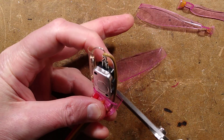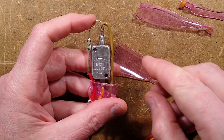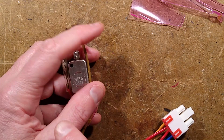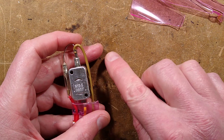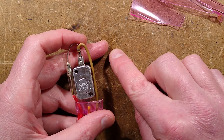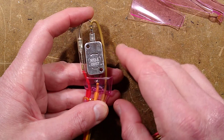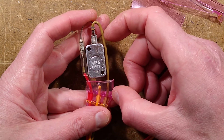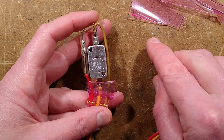It's quite interesting the way these work because everything's cost-engineered. There's a geared motor that initiates a defrost — it's very slow, with a little cam that swipes around. When it turns on the heater, it switches the motor itself off. And then if it were to continue, it would almost immediately switch back to the motor running again. Because of the way it's configured in the circuitry, the motor switches itself off and brings the heater on. But as soon as the heater is up to temperature and the thermostat goes open circuit, the motor is effectively wired across it — so the motor starts again, finding a path through the heater, and then it terminates the defrost. It's quite interesting.